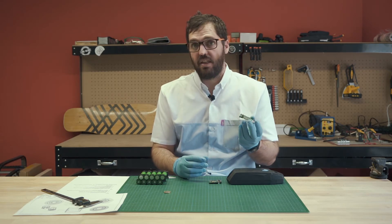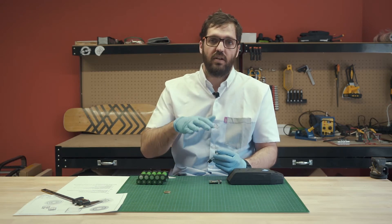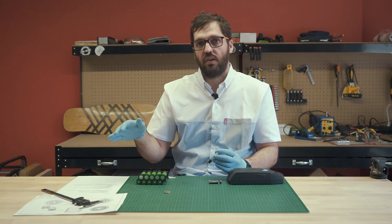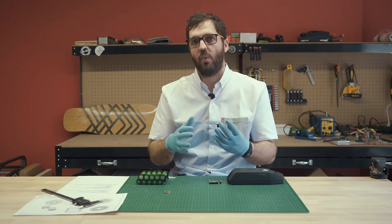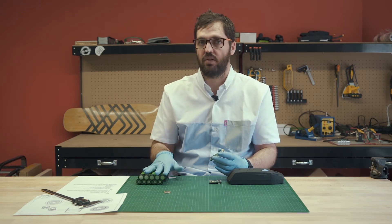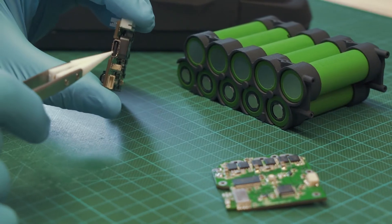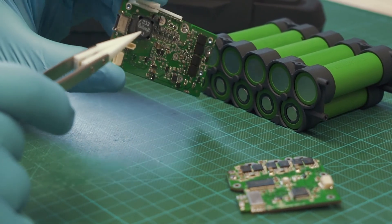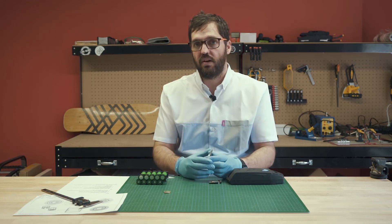Our BMS, like the motor controller, has CAN communications. We have Solo, Cruiser, and R configurations. So depending on each configuration, they communicate and decide the best way to handle the energy and the safest way as well. CAN communication is very important for us. Our BMS also has a USB Type-C port, so you can connect your phones and accessories. Type-C is the future when stepping forward.